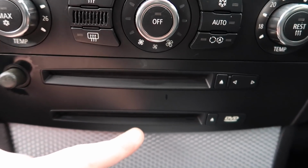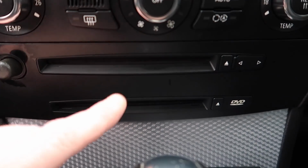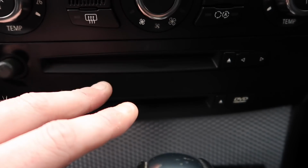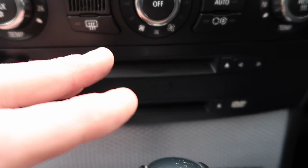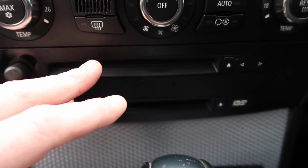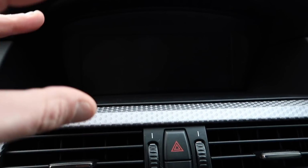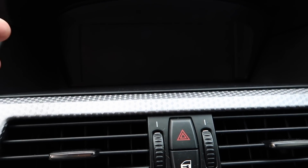The next one on these guys is the iDrive system. Now, as you guys know, the iDrive system likes to fail a lot, and I'll explain the reason for this. There's a fan inside it, and any cars prior 2003 2005, the iDrives like to fail. They were a known fault. BMW even knew that, and this is why these cars were under warranty and being replaced. The fan ends up giving up on them, which causes them to overheat, which causes your display to either keep flashing or going on and not booting up quick enough, or not booting up at all.